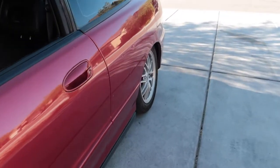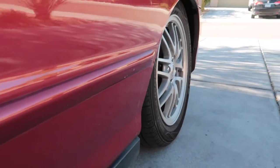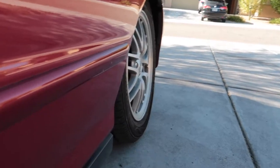From the outside view it's really not that bad. I thought I'd get more camber, but the adjusters max out at negative five degrees plus whatever the car's natural low stance adds — maybe around negative seven total.